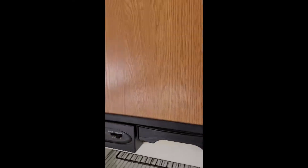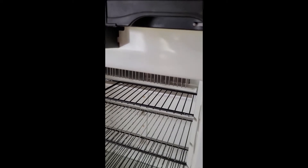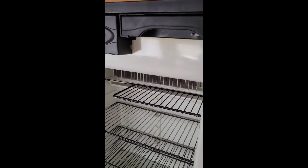Let me give you a little roundup of what I did. I did all the work without videoing it — I'm going to start videoing more — but I just wanted to go through it. First, I tested the thermostat. There are great videos out there on how to do that. Make sure that's right because that's huge — it's cheap, only $18 off Amazon. You put your ohms meter on there, unplug it, and mine was in spec. The Norcold guy's website gives you those specs and a lot of troubleshooting tools, which I also used.